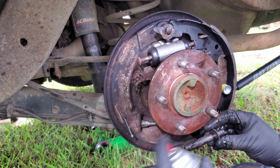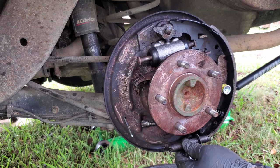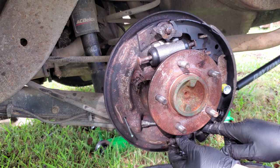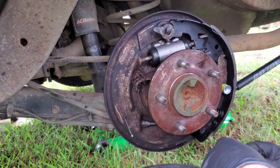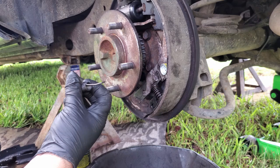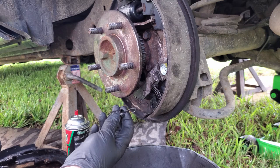This is one thing you do want to clean because it threads in and out and a lot of times I get brake dust buildup on it. Doesn't hurt to put some anti-seize on it, but this one moves pretty good so I'm gonna skip the anti-seize this time. It also has a direction that it goes in - it goes that way - so if you put it the other way your spring will get in the way, plus the adjuster arm won't hit it at all. It sits in there just like that. We're gonna put our spring in there first and then kind of cram it all in at one time. This is where you resort back to your pictures and see which way it goes.